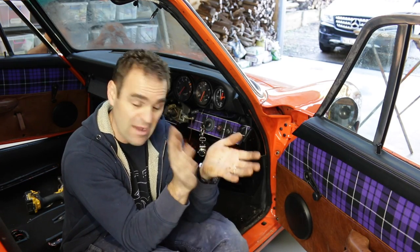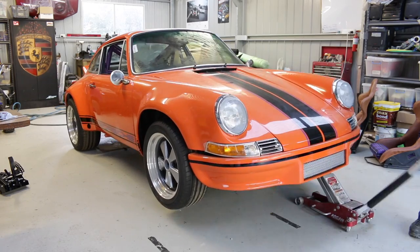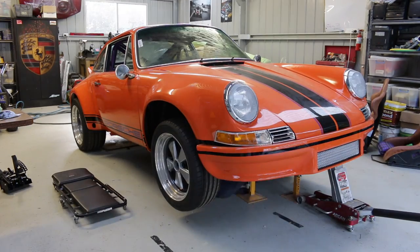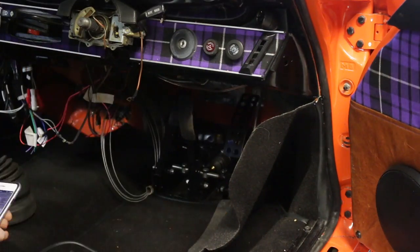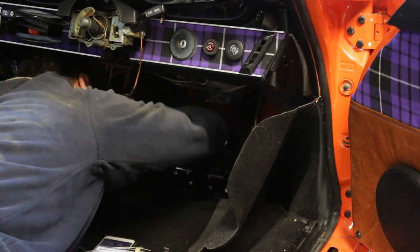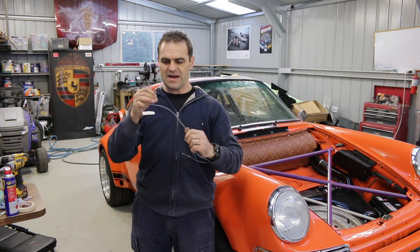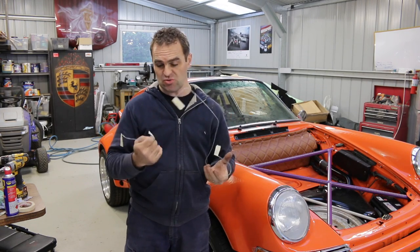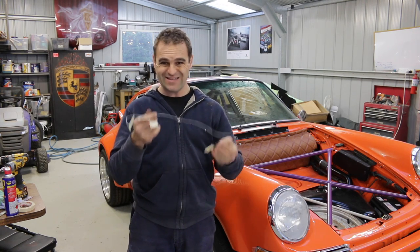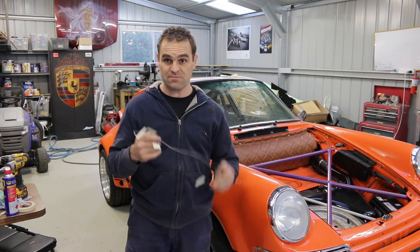It means I can still go ahead and connect up the brakes. Connecting the brakes means I need to work out what hard brake lines I need, because I'm going to have to get some new hard brake lines to run to my master cylinders. After a bit of playing around, I've got a couple bits of old coat hanger and made a rough mock-up of the brake lines I need to join into what I've currently got underneath the car. I'll take these in as templates, straighten them out, have them made, and bend them myself. Should hopefully have some brakes hooked up.